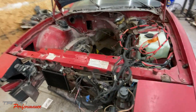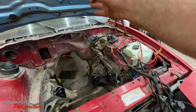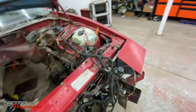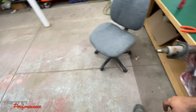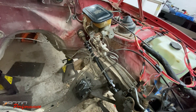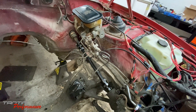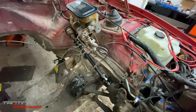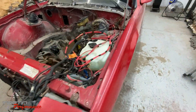I got the shaft in there - that was an act of Congress. I couldn't get the end off the '85 steering shaft, but the factory shaft from this '84 slid right on. I cleaned it up with emery cloth and finished it with a flap disc on the die grinder, then smacked it on with a brass punch. It's on there nice and tight, set screws are through it with Loctite and lock nuts locked down. I'm fairly happy with the steering and fairly certain it's pretty close to being centered.